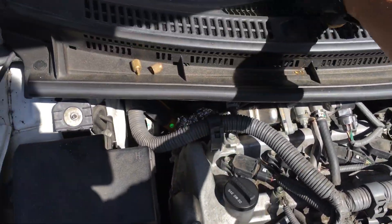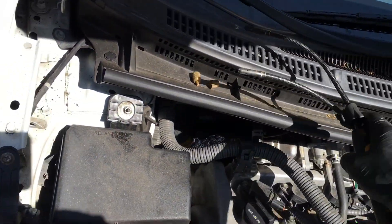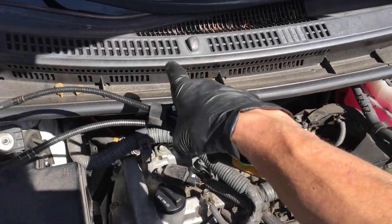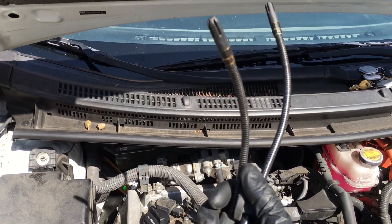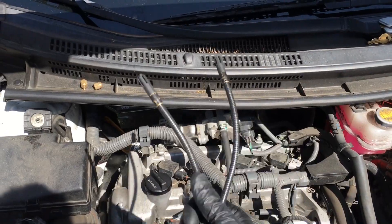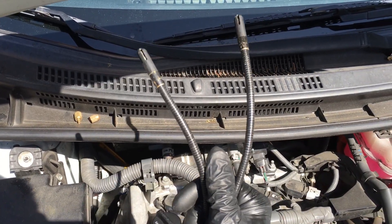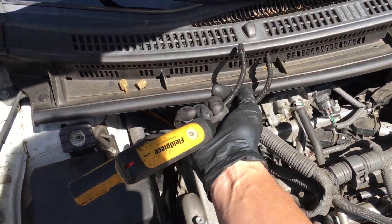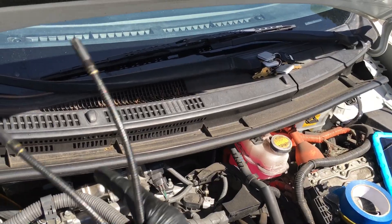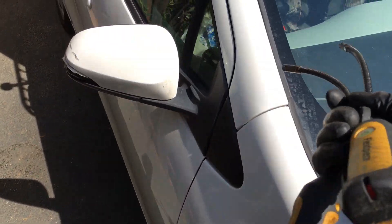The air humidity and temperature sensor will go inside here, down into the hole in the dash on the outside of the firewall, right on top of the cabin air filter. This gives a true air temperature at the mix point as air comes off the road. You want the true inlet air temperature at the cabin air filter, not measured at various other locations where you'd get different readings.